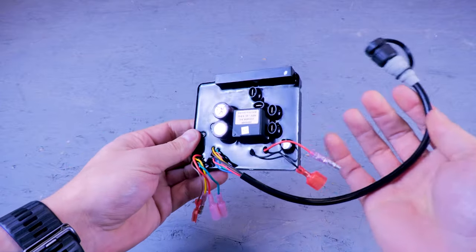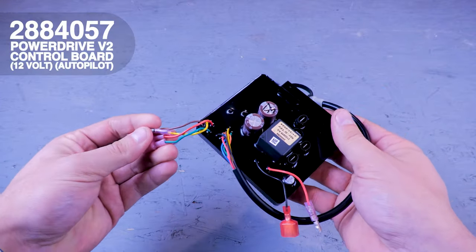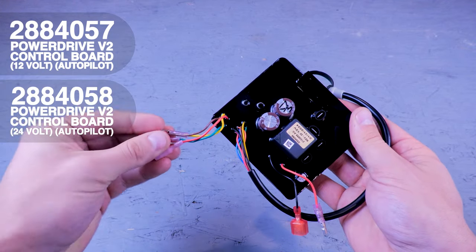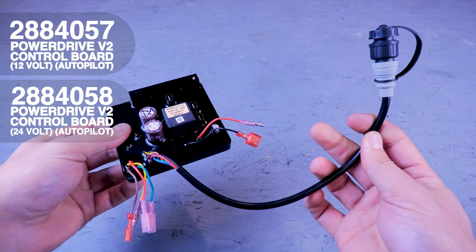Now if you're installing this on a PowerDrive with autopilot, Minn Kota makes a version of this board that will have your additional autopilot wires on it. The 12-volt part number for this board is 288-4057, and the 24-volt part number is 288-4058. I'll have links for all of these down in the description.